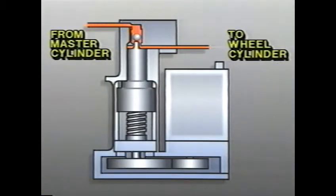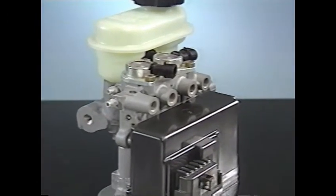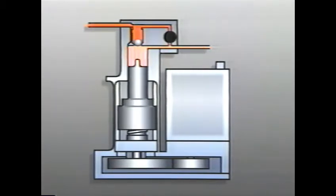If the pressure in a hydraulic passage is to drop when a piston retracts, that passage has to be sealed away from the brake pedal pressure. Normally, the passages between the master cylinder and the brake calipers are kept open by check valves, which are controlled by the pistons. But when a piston moves down during anti-lock operation, it closes the check valve and seals the passage. As an added safety feature, two solenoid valves in the front brake pressure system let the brake fluid bypass the ABS components during normal braking. These solenoids are normally open, meaning any time they are turned off, the front brake passages are held open to the master cylinder, so no failure of the ABS system can ever cause the front brakes to malfunction. During anti-lock operation, the ABS control module closes both solenoid valves so that all the brake fluid must go past the piston. When the piston closes the check valve, the brake passage for this wheel is completely isolated from the master cylinder.